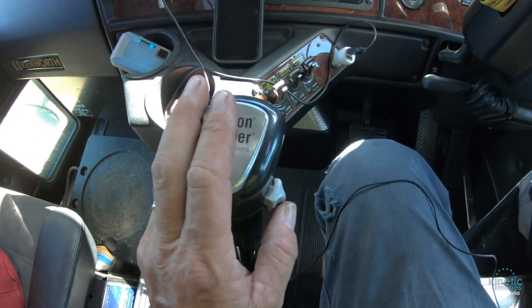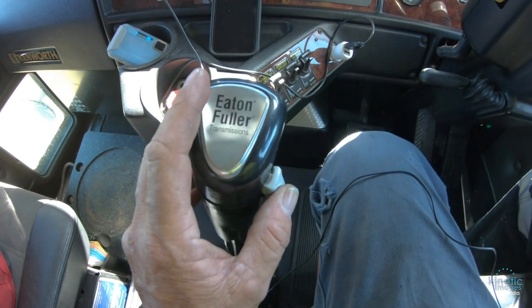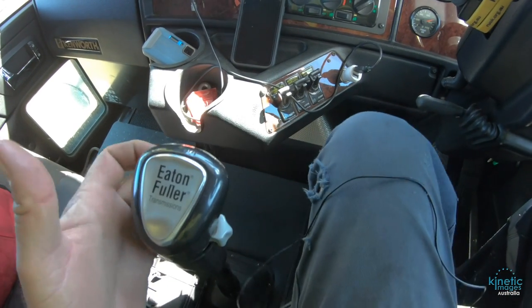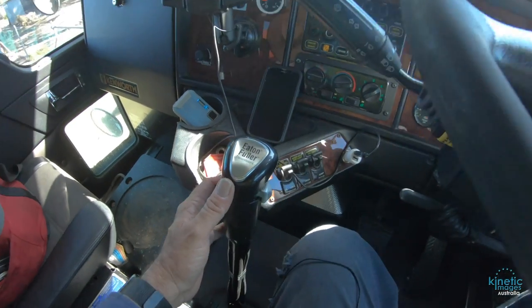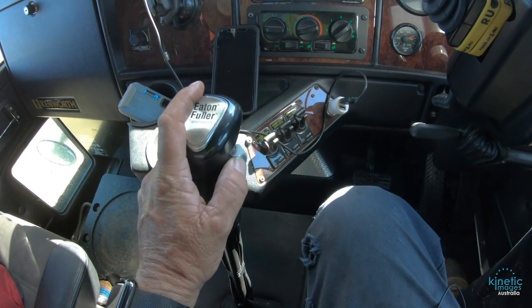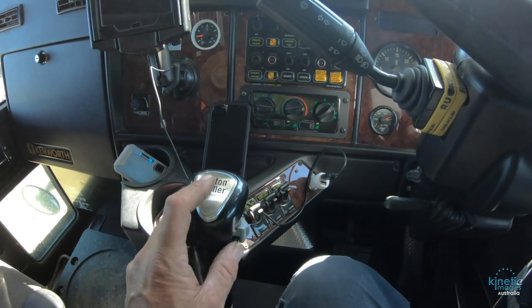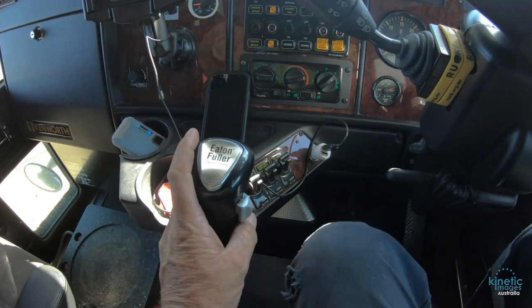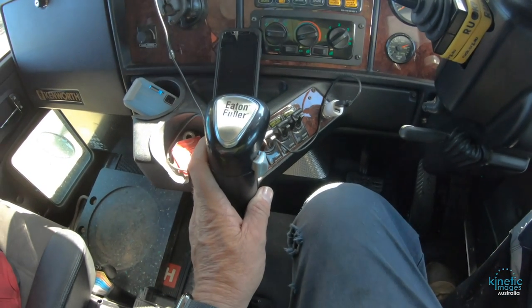Just remember that when you're making a split in an upshift or coming back and doing a downshift with the split, remember it's a lot quicker on the revs. When you split it's quick, when you unsplit it's quick. Don't be shy — split any time you want. It's very helpful if you just want that little bit of speed to get up a hill and need just a little bit of extra revs. If I wanted to downshift, I'd go straight back in and pick up another 250-ish revs, and that will be all that I need.